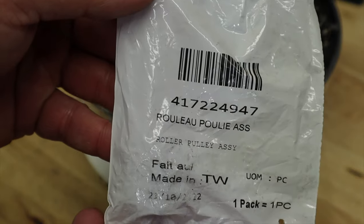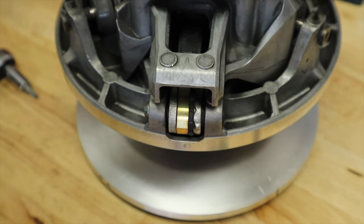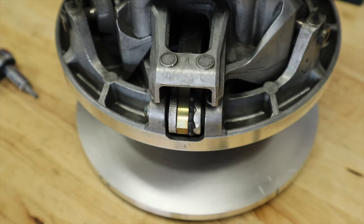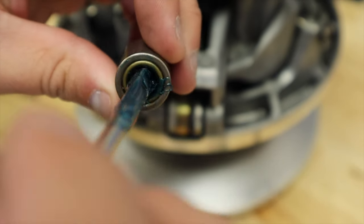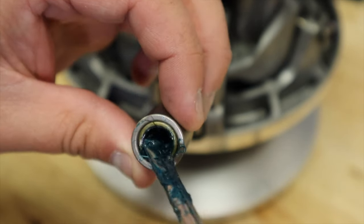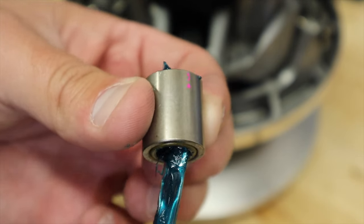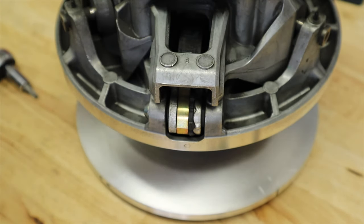Alright guys, I've got my new roller bearing right here — that is the Skidoo part number. We have one that is out and we're going to go ahead and get it all greased up. I'm going to put some waterproof grease — some Maxima waterproof grease — in there. That is going to be the final touch to this bearing before we install it. Now you want to be kind of careful here — when you get done doing this and you want to run your sled, run it for just a minute or two without the belt installed. Don't rev it up, don't stretch your clutch out, and let this grease kind of evacuate the bearing. The last thing you want is grease on your belt.